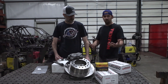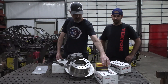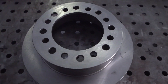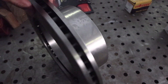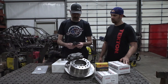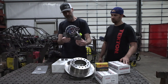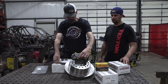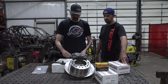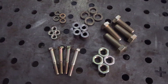So what comes in the kit? You get two calipers, two sets of pads in one box. You get two rotors that are already drilled for both bolt patterns — that's standard for Super Duty and 14-bolt categories, so you'll always get double-drilled rotors. You get your caliper brackets, which bolt to the knuckle and to the calipers. You'll also get all of the spacers — the 3/8" ID spacers bolt the calipers to the brackets — plus 5/8" hardware to attach the brackets to the anchor bolts and knuckles, along with lock washers and nuts.